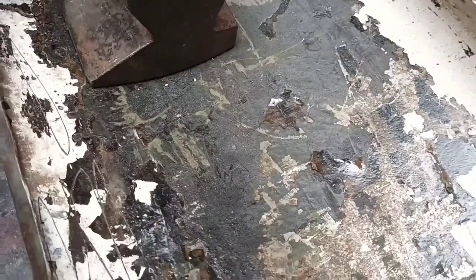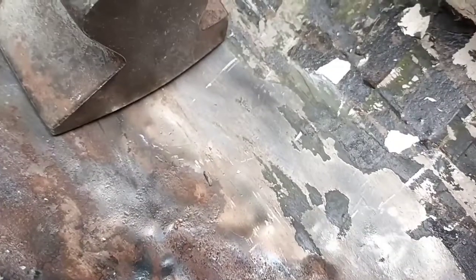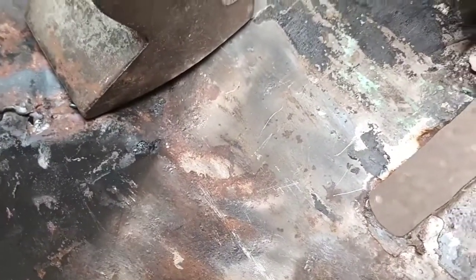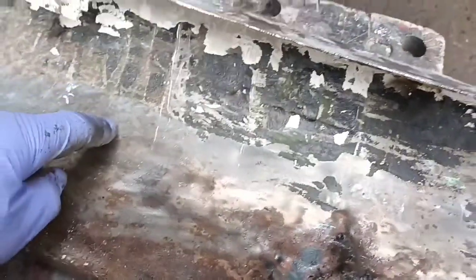This dolly will show the extent of that bulge. I mean, there, you can see that. That fits perfect all the way along there. When we get to here, we start to get a gap. There's probably 2 mil under that, under the centre. And there, where the damage is, we've got 4 mil. And it's still gapped. And sort of there, it becomes okay. So we're looking here to here.